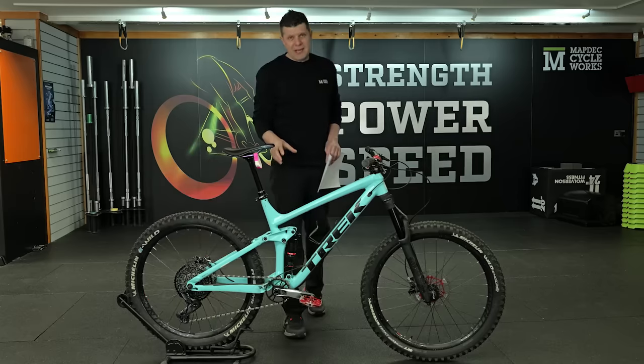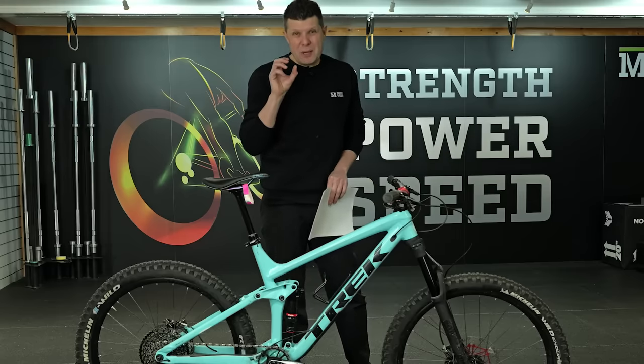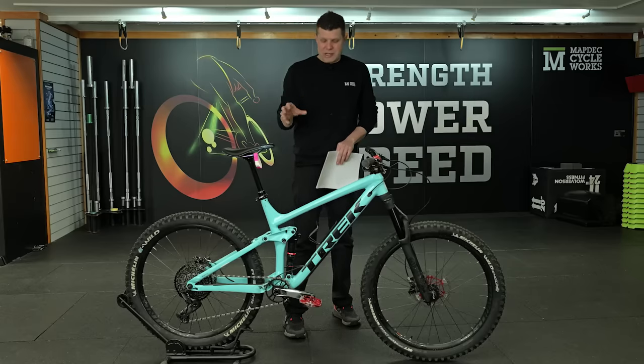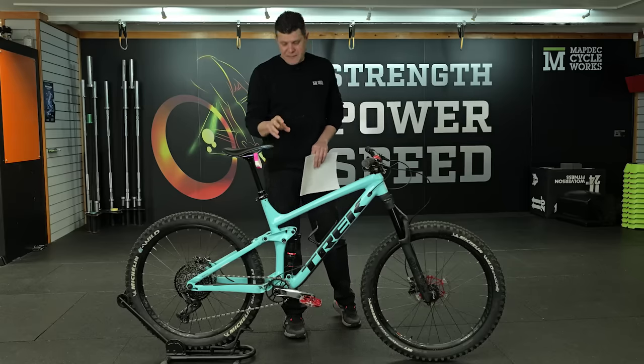When it came to the bottom bracket, we obviously saw that wear and tear on the actual axle itself. There's not much we can do about it, but it was just at that point where we could probably get away with it. If it was a road bike, I would definitely be changing it, because it's gonna creak and creak and creak, and this will probably creak at some point. But right now it's spinning, it's fairly solid.